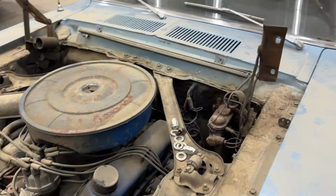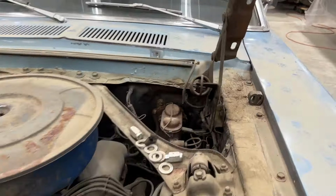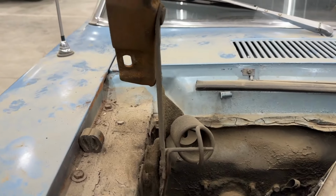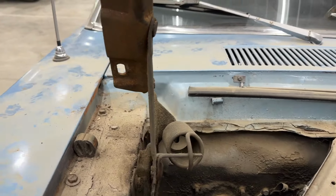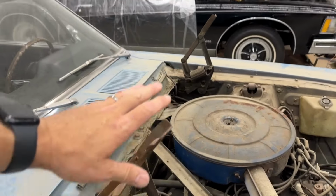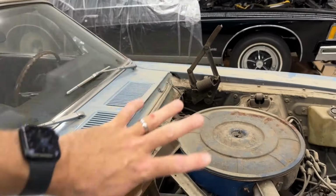And then, if you notice these hinges, take a look at this one, how it's oriented with the bars and everything. And if you slide over here to this one, you might not notice, but it's obvious to me that this is bent. And also, this is kind of tweaked up this way. So my advice is, let's just put new hinges on it. Let's tweak that back into place and mount the new hinges.